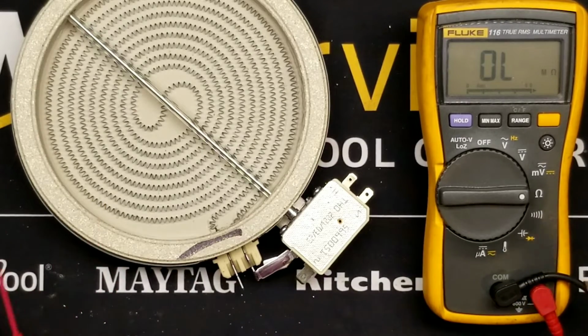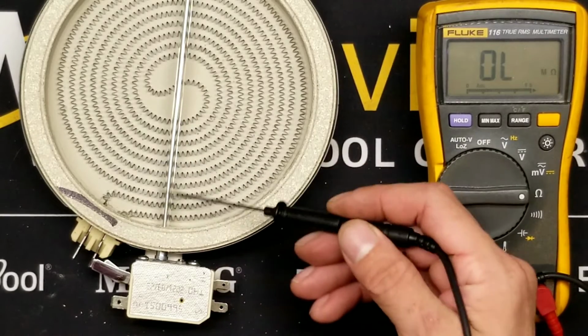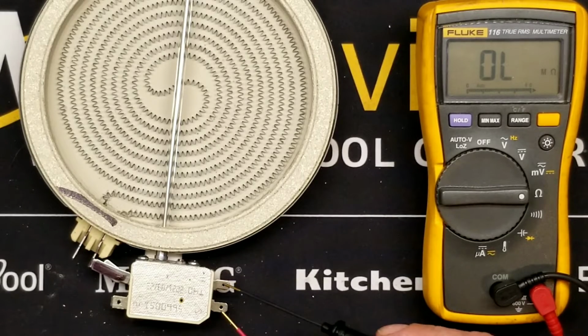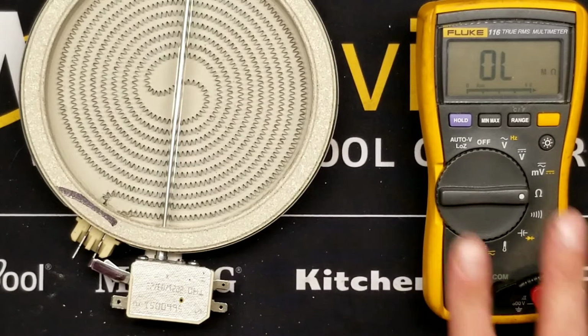All right, so that is pretty much it. We can talk about these two terminals over here. These are the same device, but they have a whole different function. These are just a switch output to activate the cooktop is hot indicator. The same rod, if this gets over a much lower temperature, say 200 degrees Fahrenheit, these contacts close and they light up that indicator. And generally all of the elements of the cooktop will be common together, so that if any one of the elements indicators close, then the light would light up and say something on the cooktop is hot.